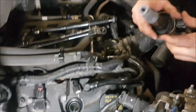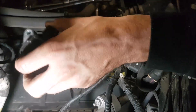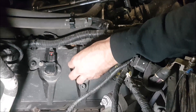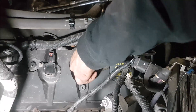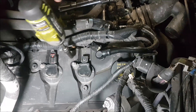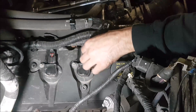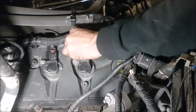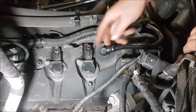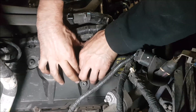Make sure your boot is nice and clean and try not to put your hands on it, because any dirt can cause premature arcing. Put the coil back in, tighten it down — don't go overly tight. The connectors here are a bit stiff to put on; make sure they come all the way down and clip in securely.